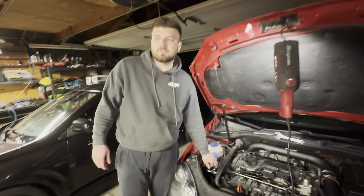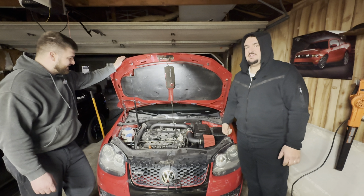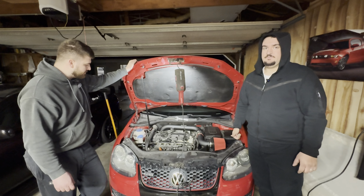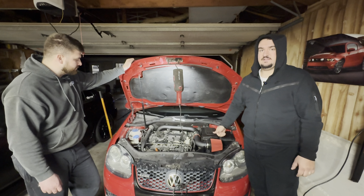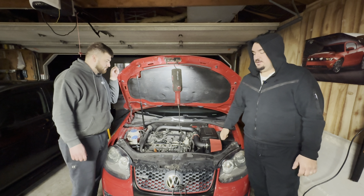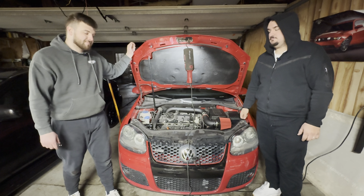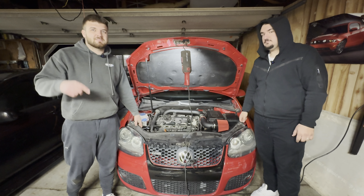Alright, let's go ahead and mount it. This is the return line, this is the feed line. The return line is going to be going right here. Go ahead and just connect them before installing because it's going to make it a lot easier once you put everything together — much easier than fully mounting it first and then getting the screws threaded in. So just kind of don't go too tight — we're threading on the bottom of the catch can. Now the bottom is threaded in. That's what it's going to look like. Last piece of the puzzle — thread it in and that is that.